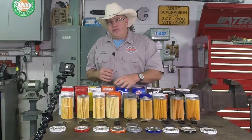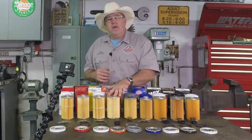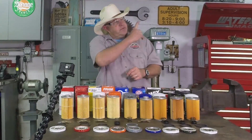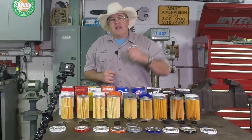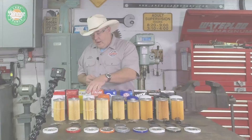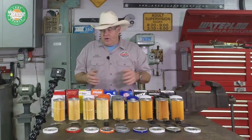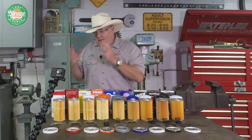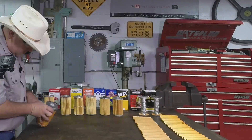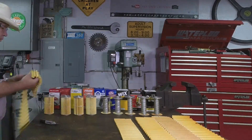I'm quite surprised by the quality of this Fram filter — it's actually significantly better than anything I found in my prior videos on Fram filters. If you haven't seen those, I'll put a link up so you can go see the other video I did on automotive filters. Now the Rotella, the Purolator, and the CarQuest filters are identical — same manufacturer made all three. So the next order of business: let's cut all the filter material out of these and lay it out to see who has the most filter material.